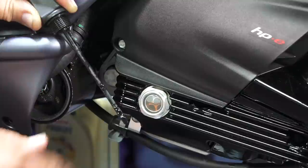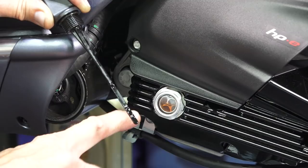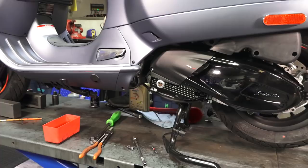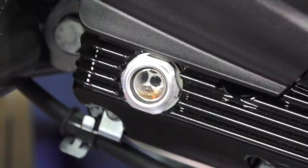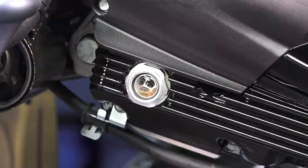You don't want to overflow where the entire window is solid with oil — that's too much. I'm going to start this motor for the first time. It'll go a little bit lower as it repressurizes the system including the oil filter. Then I'll let it settle and make sure the oil level is right at that halfway mark. The oil pressure light goes out right away — that's a good thing. I'll let it idle for about 20 more seconds, then let it settle and watch the oil level come to the correct level.